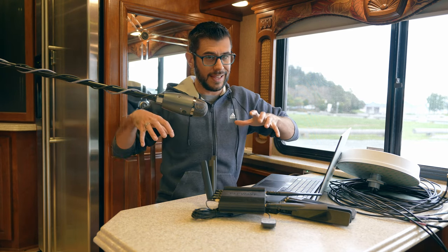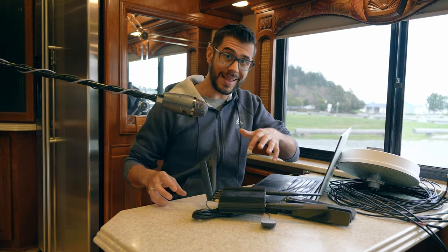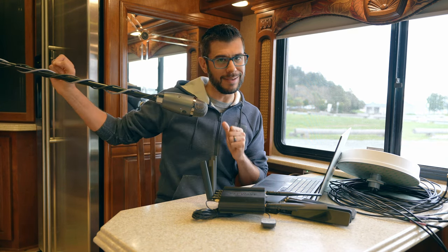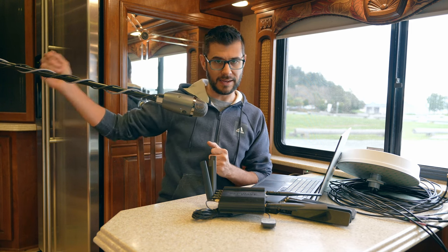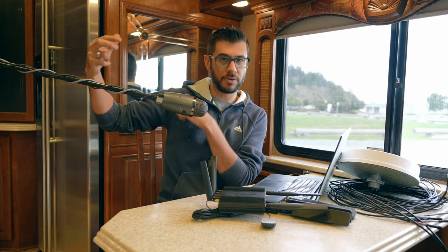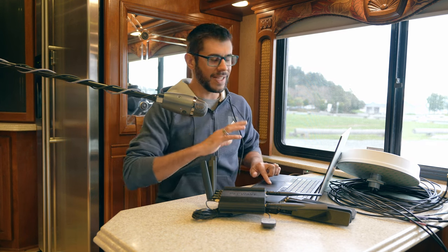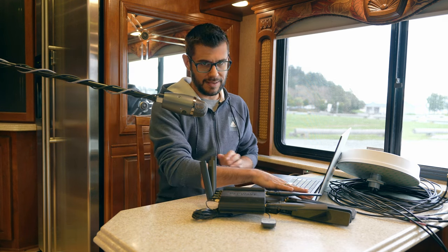We also have a mesh network of routers that connect to that one, and that is a client in itself. So that router is connected to one of our LAN ports here, and that is a client of the router. So we just select that we want that router to be the bonded client. And all of the traffic going through our secondary router is bonded. So that's kind of a high level what the client means.